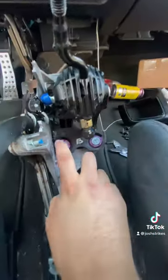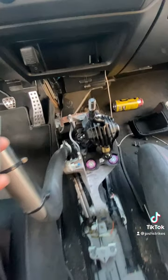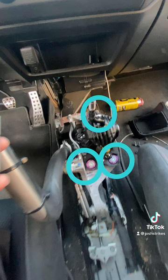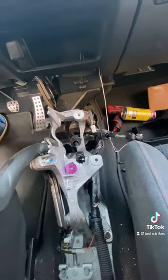Once you've freed the holders, make sure they're off to the side. Go ahead and unbolt your shifter as well. Keep in mind that my shift holder nuts and bolts are from an Acuity, so you'll have regular bolts with rubber grommets if you haven't switched them out — I think they're 12 or 14 mil bolts.